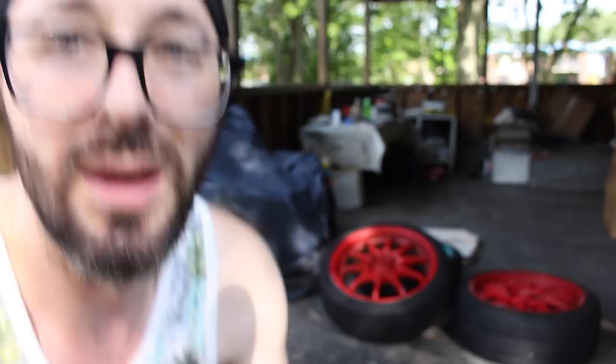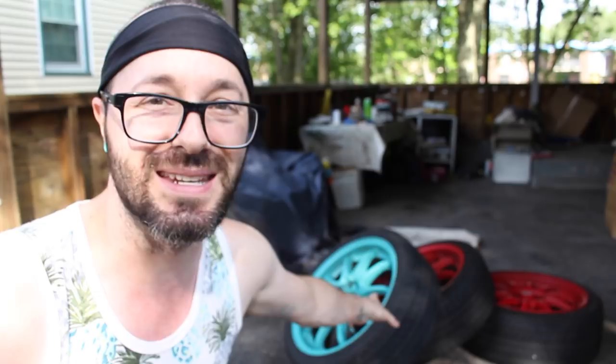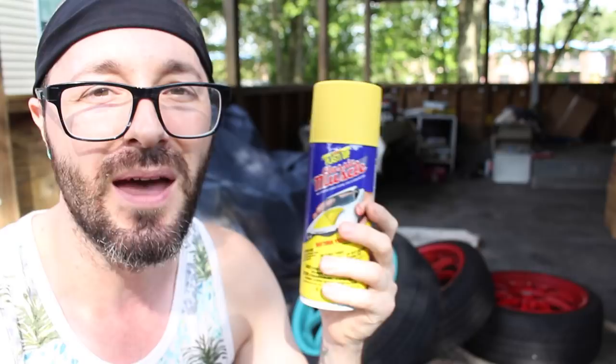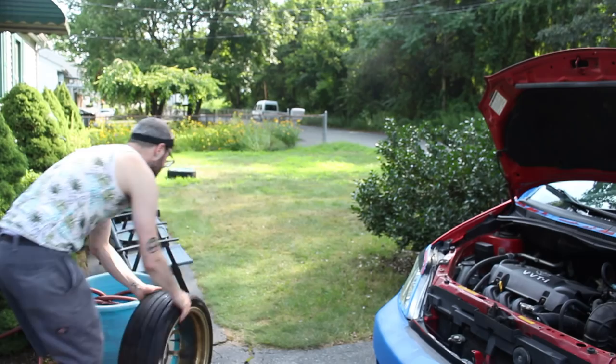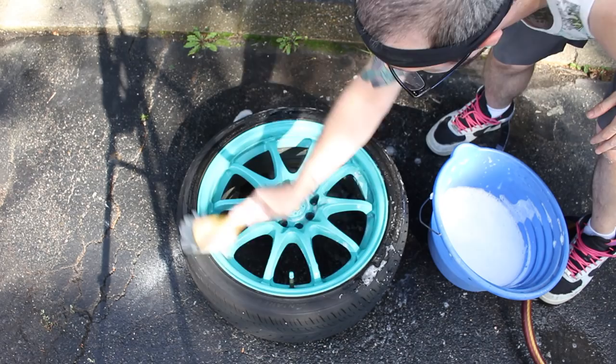Alright guys, I got my wheels out of storage. These are the old wheels that were on the other M-cart. They're red and blue, but we're going to be painting them with some Plasti Dip. The can I got is Daytona Yellow — 1969 Daytona Yellow. There's already a couple layers of Plasti Dip on these wheels, so I won't need a whole lot, but normally if you're going from scratch, you want five, maybe seven coats so it holds up. We're just going to clean these off and maybe get away with two or three coats.